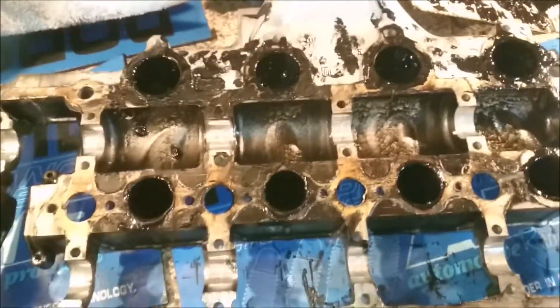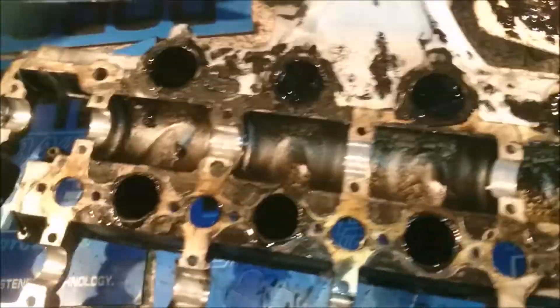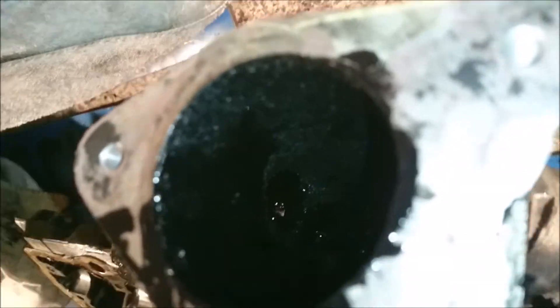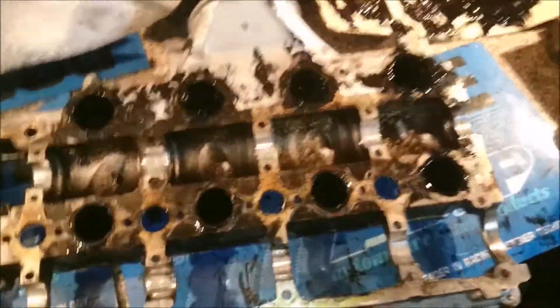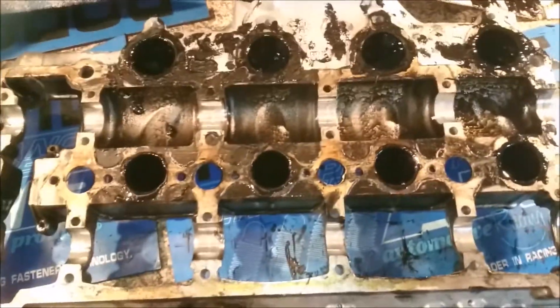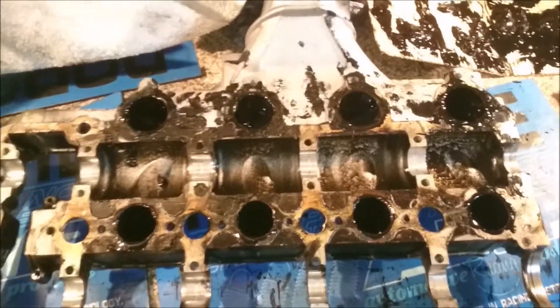We won't be doing that - better clean that up. I couldn't bring myself to attack this with a pressure washer because I'm in a right mess of the drive. At the end you can see that's about 30 or 40 blobs from me getting my finger in there and scraping it out - you can probably see the scrape marks. There are two sections in the manifold that disappear off either side, and they were completely entirely blocked - unbelievable. The outer ones were more blocked than the middle ones - I don't know why, maybe temperature change. So I'm going to fill this with petrol and leave it to soak, then clean it off another day. What a mess.